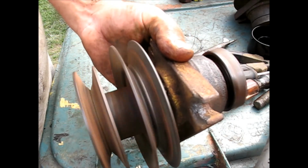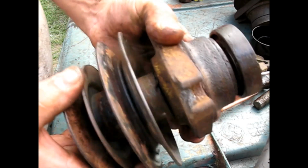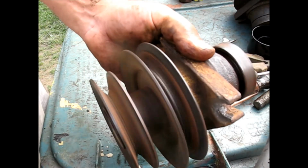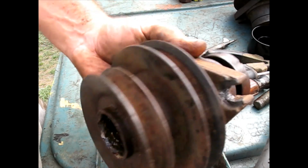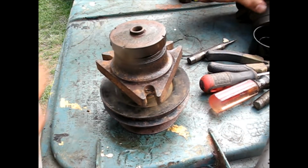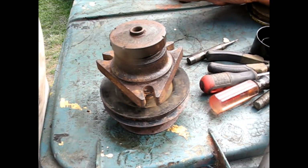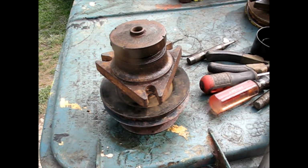They're growling just a hair. They're not really, yeah, it's got a little play. But if they just keep spinning like that, you can tell there's no grease going around with those bearings. If there was, it would stop much quicker than that. For example, that's the new bearings with their proper grease. So, just a little tip, if you ever see something wrapped along there, you're going to shorten the life of those bearings real bad.